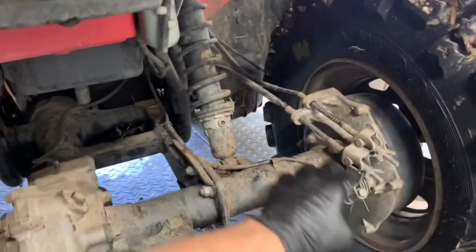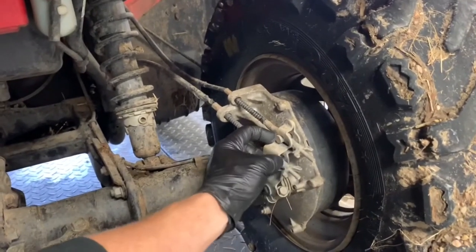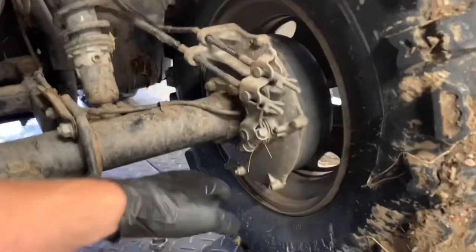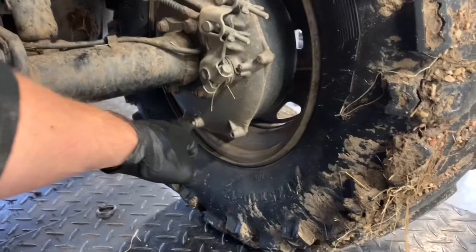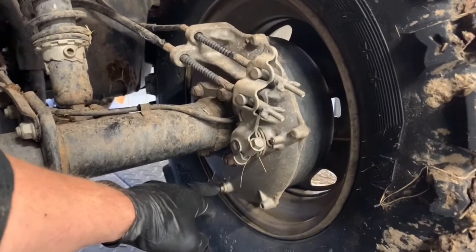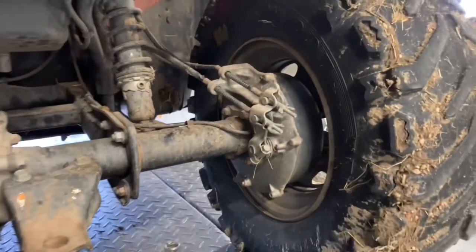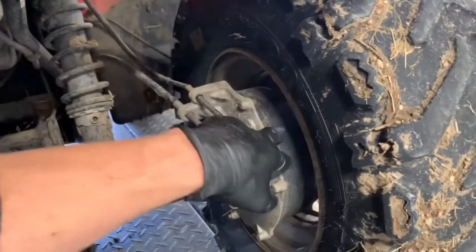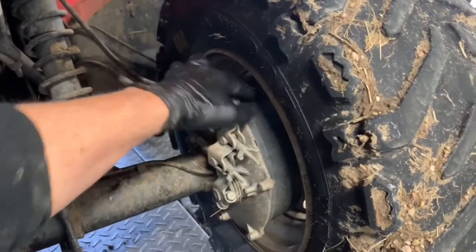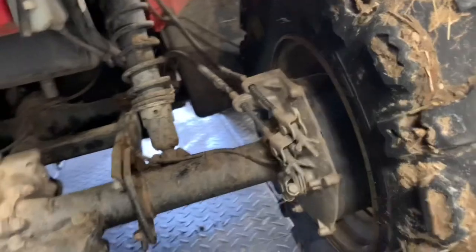Here are our rear drum brakes. We've got a cable that runs up to the handlebars — typically that's the top one — and this one runs to your right-hand foot pedal. You want to make sure there's a little bit of a gap between your post and the actual arm so you're not constantly wearing those down. The rear brake housing has a drain bolt — sometimes you'll run through water and you'll want to drain any water in this housing. There's a 10-millimeter bolt right here on the bottom; you'll also want to replace the crush washer if you pull that bolt. To replace the brake shoes, you've got to pull the rear tire, the rear hub, and this cover — 8-millimeter bolts all the way around. There'll be a drum inside, then right there you'll see your shoes.